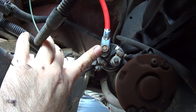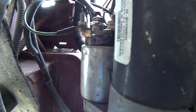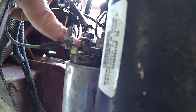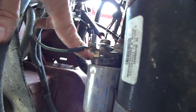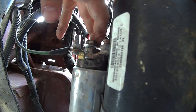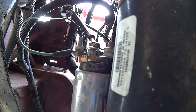We got this baby tight. Sometimes when you loosen this up, that post goes into the solenoid and tends to work loose, so be sure not to let that happen. You want to tighten it up but don't get crazy cranking it down - you don't want to break it and have to get a new starter. When you tighten this down you want it hard snug but don't go crazy, because buying new parts when it's not necessary is a very expensive thing. Don't be cranking too much and breaking stuff.